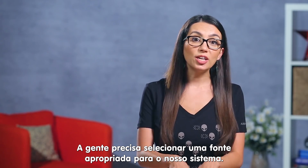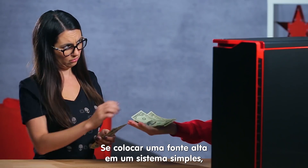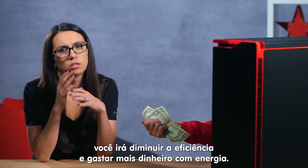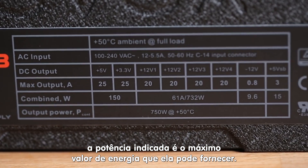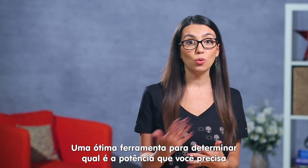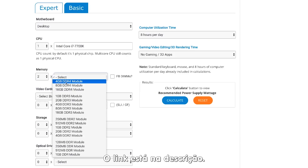But that's not necessarily true. You'll want to size your PSU appropriately for your system. Too high of a load into a basic system actually decreases your efficiency and costs you more money over time. When it comes to your power supply unit, or PSU, the wattage listed is the maximum amount of energy it could possibly supply. A great tool I like to use to determine how many watts you might need is the Outer Vision Power Supply Calculator, and it's linked in the description below. You're welcome!